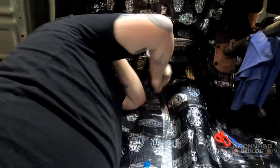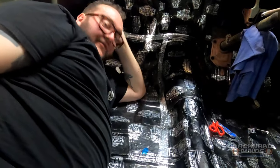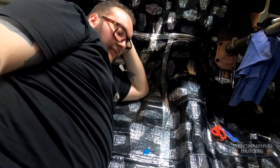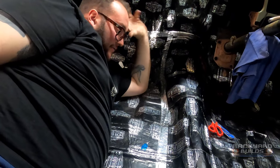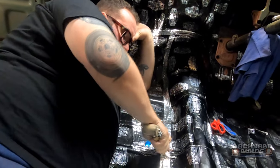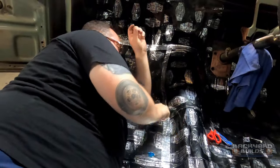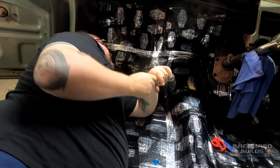Can you explain what you're doing there? What's all the silver tape for? So it's just a foil tape. What the foil tape actually does is seal the edges up in between the sheets - a bit more of a moisture barrier to stop water wicking in under it. Carbuilders recommend using it - this is actually from them, their van tape or van interlayer tape, but it's the same stuff essentially. So you just put it over all the joints, roll it in.